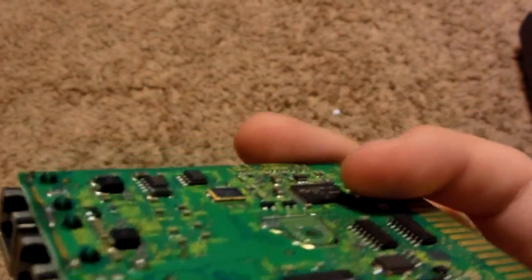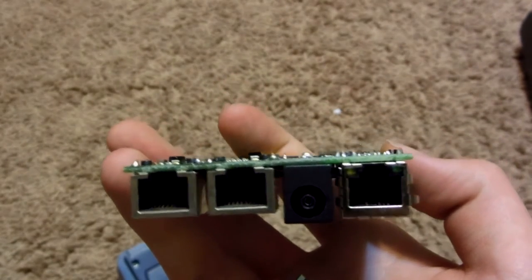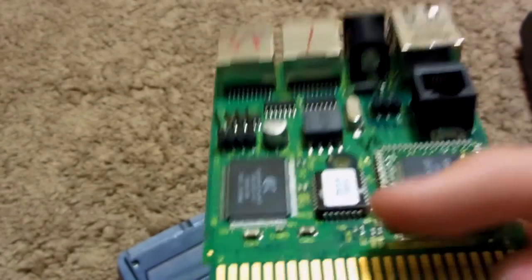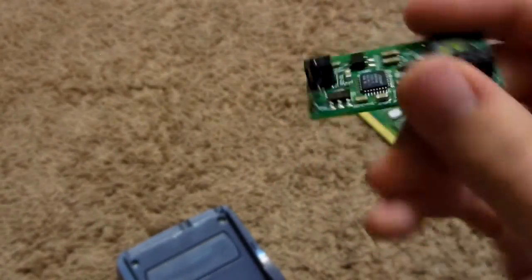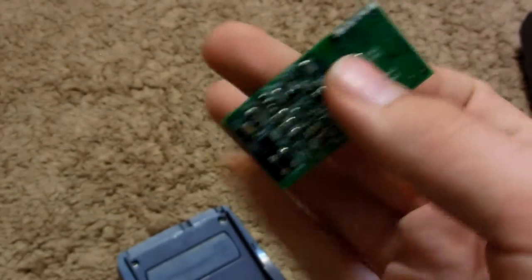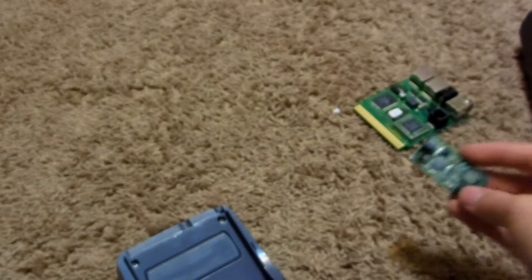It's a gold-sided piece. We also have three front connectors that will have gold. The second one to the right will not have anything in it, so don't worry about desoldering that if you are into processing boards. Here we have some IDE pins, however they're not gold-plated — there's no shiny gold in them, so you don't need to worry about removing those pins. On this one it looks like two pin sockets should have some gold because they're not like low-grade boards. On the back there are some nice chunky MLCCs as well as a lot of capacitors to remove, and a tiny little chip.